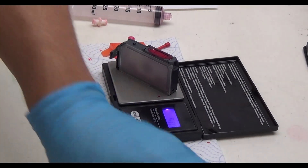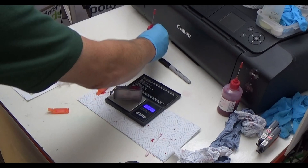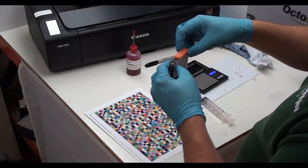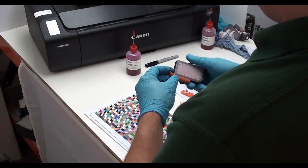Now that I'm there, I'll clean off my needle, put my scabbard back on the bottle like so, and pop it out of the way. What we do next is stick the storage clip — this isn't a flush clip, just a standard storage clip that you normally get with your cartridge — stick that on, then shake your cartridge for about a minute to try and mix the ink you've just put in there with whatever was left in your cartridge to dilute it down as much as humanly possible. You'll notice I'm basically shaking it from side to side, end to end, and also front to back. Right, that should be about enough.